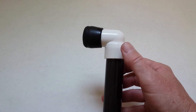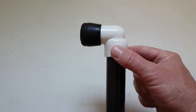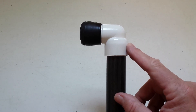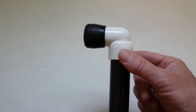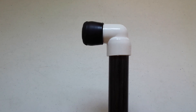When you're satisfied with how everything's mounted, use a little bit of marine goop in here as a sealant to keep it tight. Once it dries it's not going to move. But if for some reason you ever have to remove this 90 degree fitting, just take a heat gun to it and it'll loosen up the marine goop and you can twist it right off. That's how I made that 90 degree turn in the top of the shaft.